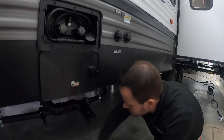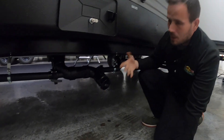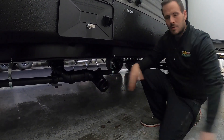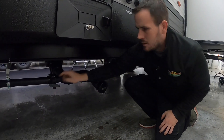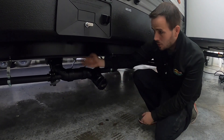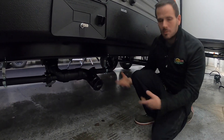Down here below, you're going to have your actual dump stations. You have three — one way back here which is your black. The big three-inch pipe is always your black tank. Always make sure it's closed before you use it. If you had it open and start using the toilet, all that black water will come flying out at you when you take the cap off. Before you start camping, always make sure all your valves are shut. When dumping, it's always best to do your black tank first — hook your hose up, open your black tank, let it finish, close it. Then you can pull your grays. This prevents black water backwashing and also helps clean out your hose with cleaner gray water.